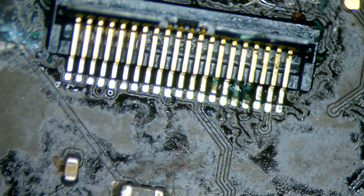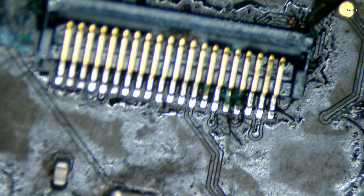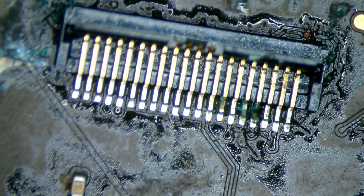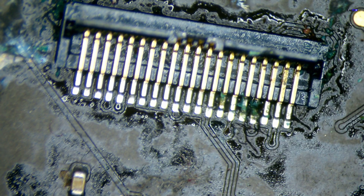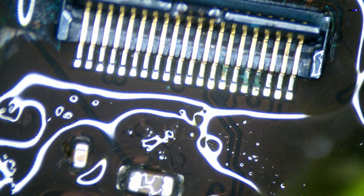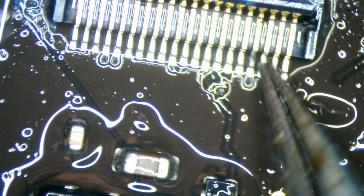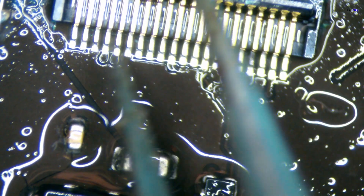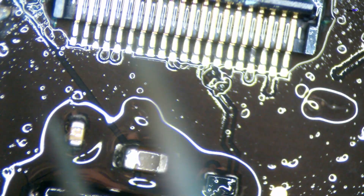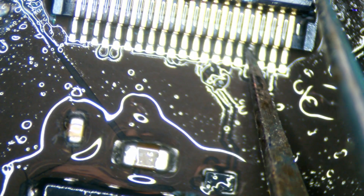Oh, I love this under the microscope — looks so much better. You guys can actually see it. It's a great instance of why — if I would have just pulled it, sometimes it could be yanking under here, or if there's a big chunk of green or something like that, that could be a problem. So we don't want to do that. Right now it doesn't look to be too terrible. We'll just put a little bit of our 99.9% alcohol right over there. Look how much better that is already. I want to make sure the flap — because the flap can be easily damaged. Look how much better that looks. The pins look to be fine; even this one's still a little bit dark, but the bottom of the pins actually looks to be pretty good so there's no real true impact here. But we still want to make sure that this is cleaned up.